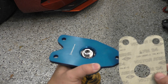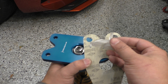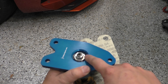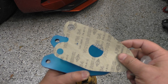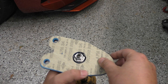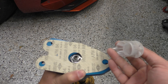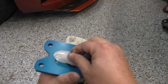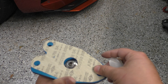The gasket has this little hole for the tail in the top cap — you can see that on the left — but we're actually not going to be reusing this top cap anyway, because this hole for the spherical bearing is much bigger than the hole on the OE top mount. If you overlay them, you can clearly see the OE hole size is smaller. So if you tried to put the cap on, it would just sit very loosely in there — it's not sitting snug in the recess and snapping into place. So we won't be reusing it, but we will be placing the gasket over here.